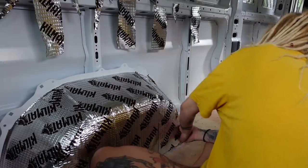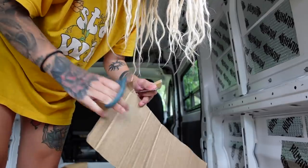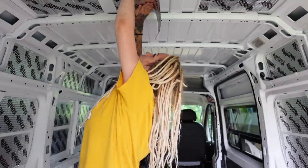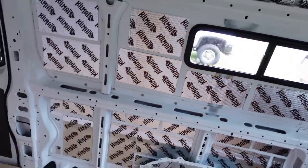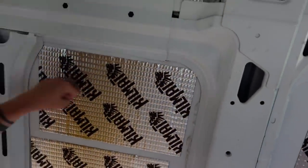Two boxes of the sound deadening material cost me about $120. I only ended up using one and a half boxes, and in the beginning I kind of questioned if it was even worth getting, but after installing it I definitely think it was because you can definitely tell the difference in here — it is a lot quieter now. I put it on as much area as I could with little spaces in between, and left a space for when we put in the air vent. Now when I knock on it, it's a lot more dull than it was before — before it was very harsh like a tin can, and now it's just like a thud.